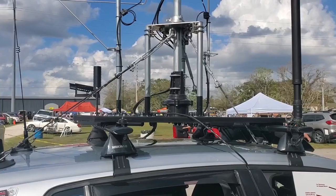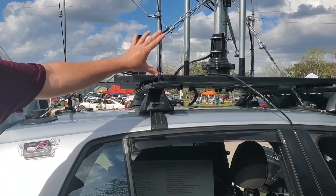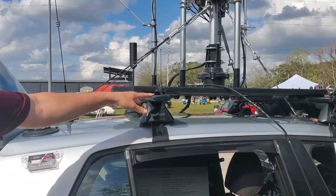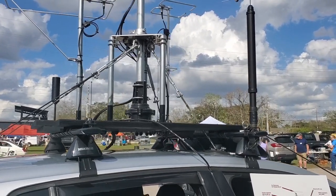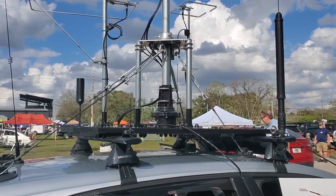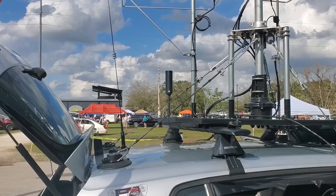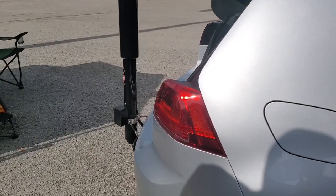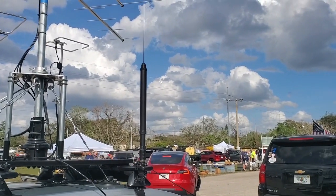For the verticals: the ATAS 120A is there because it's convenient. This little antenna I switch over from time to time — it's around 400-something megahertz, kind of wide-banded. My idea is to use it for my D-Star hotspot so I can access it around the park. I've got a mystery 902 antenna over there — the fellow standing behind you gave it to me; his mission in life is to get people on 900 megahertz. I haven't put the radio in yet because I've just been busy. There's a WeBoost cellular booster, a regular dual bander, and a Scorpion mobile HF antenna.